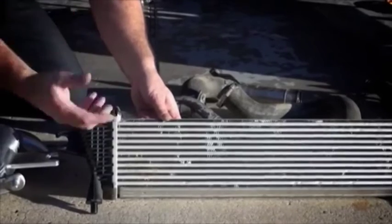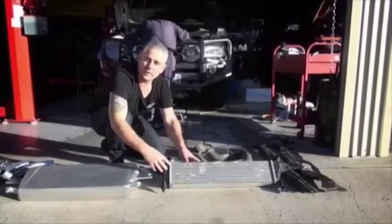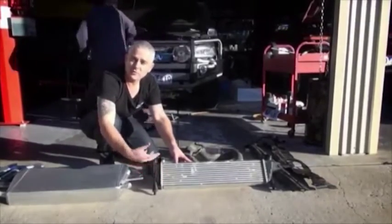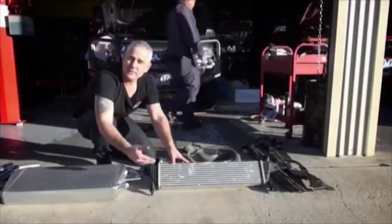So you're cooling the charge with hot air entering here, air flowing over it, and then cool air exiting out the other side of the intercooler. The whole idea is to cool the charge down, and by cooling it down you're actually creating denser air. When you talk about air fuel ratios on a vehicle, it's how many parts of air to parts of fuel.